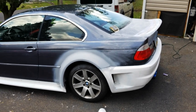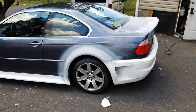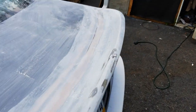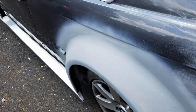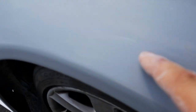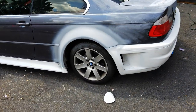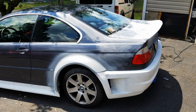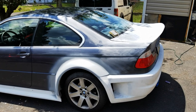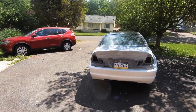So I think I'm just gonna sand it myself, buy a few cans of primer, and prime the whole car. There's a lot of imperfections like this in the wing that I can't really see with the naked eye all over the car. So I have to paint it one color like this primer because you can actually see everything — any deep scratches, stuff like that. So I'm gonna basically sand down half the car right now, buy some more primer, spray the whole rear, see what I still have to add with Bondo, and if everything is good I'm gonna sand it completely again and then it'll be ready for paint. I'm done sanding the rear.